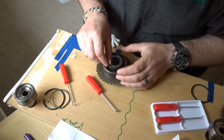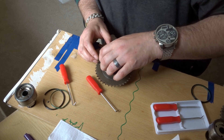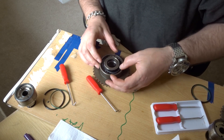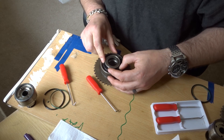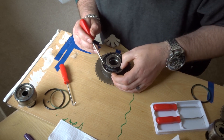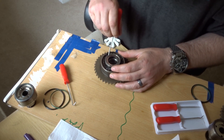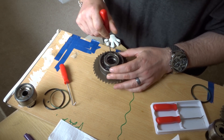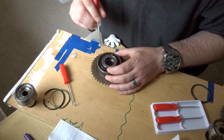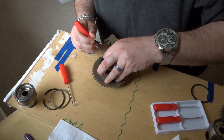Just giving it a quick dry on another bit of tissue. Now this is the very delicate part — you don't want to rush this. I managed to damage the Teflon seal on the driver's side. I'd got it all in and it was the very last millimetre — I'd got it under the plastic housing and was just making sure it was fully seated, and I managed to just nick the edge of the Teflon seal and tear it slightly. I was absolutely gutted. So you pop it down, push it down using the pick, and gently just massage it down under the plastic ring.